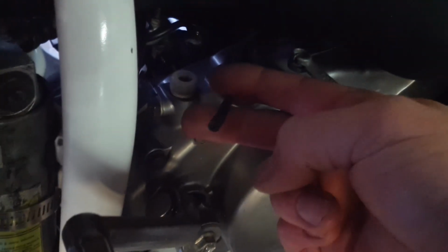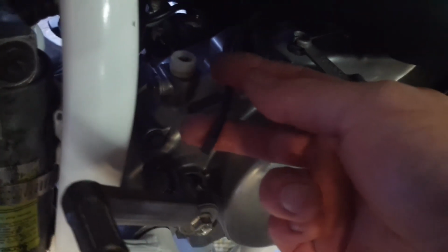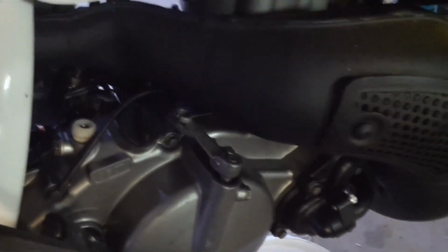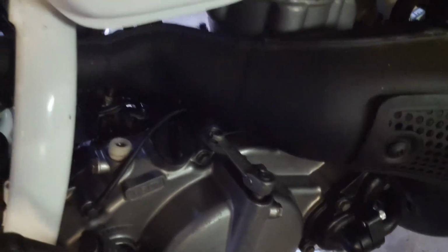I can pull a vacuum on it and I can't blow into it, so obviously there's either an obstruction in the tube itself, which I doubt, or, because the previous owner soldered up the ports on this, I did my best to unsolder them with a solder vacuum gun and soldering iron, but I must have missed a bit. I checked the carby and the air compressor can blow through the port alright, so I think that's fine.